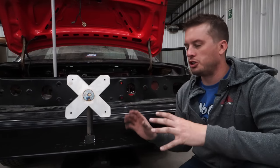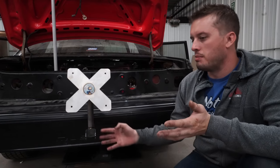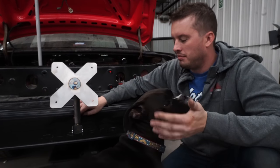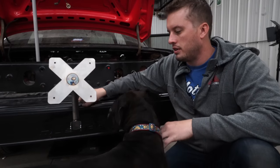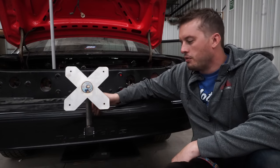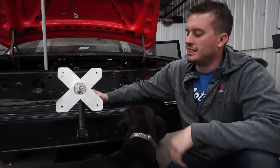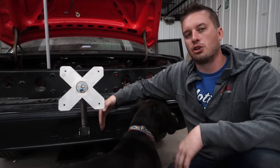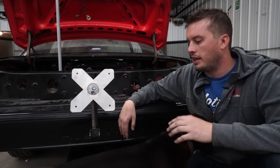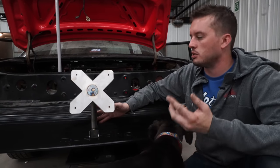One popular question we get on our parachute mounts is: can you move that up or down a little bit out of the way of the license plate? The way we build these is to hit the center of gravity on a car — you want to pull the parachute on the center of gravity. So the position is designed on purpose. Moving things up and down just to clear a license plate or put it in the license plate hole so it looks better isn't our number one priority. Our priority is to build things correctly — have them look nice but function perfectly. Center of gravity can change slightly depending on your combination, but we build around the optimal based on a stock-style build.